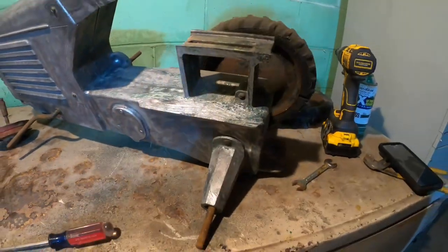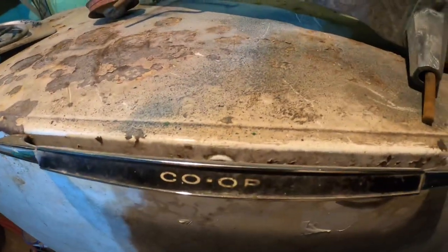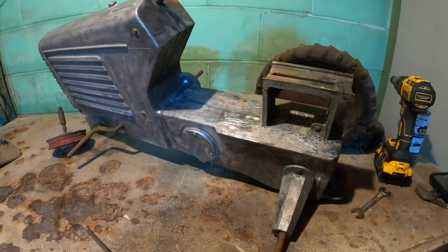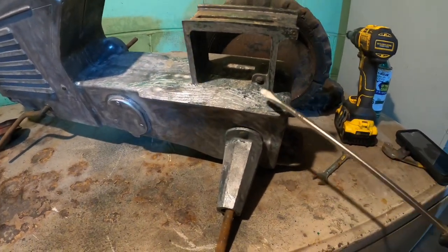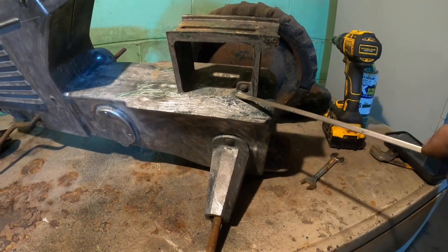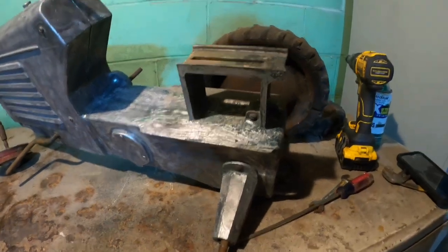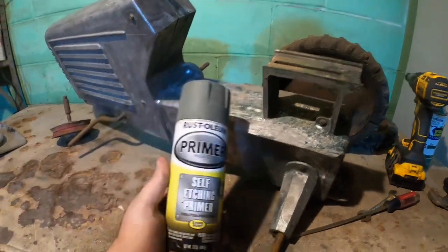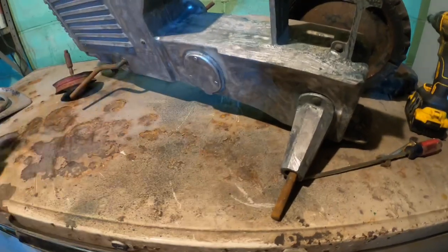I'm working on top of an antique freezer which has been in this house since I would assume Grandma and Grandpa got married — a co-op freezer, still chugging away. I've been wire brushing by hand. I've got a drill with a wire brush, and then some of this paint is so sticky I've been scraping it. I'm trying to do just enough to get the paint off but not so much that I leave gouges in the aluminum. Scratches are no big deal — the primer will take care of that. But if you make a deep cut in it, you won't get that out. And I was told an aluminum self-etching primer, because that will help the paint adhere to the aluminum better.